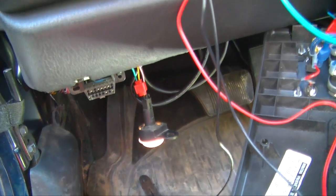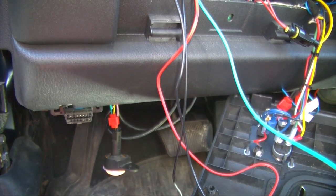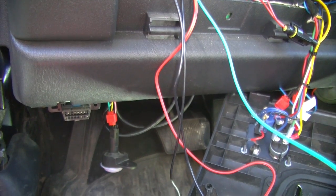For the door trigger, I tied into the yellow wire on the light — when your door is opened it automatically goes negative. The only problem with that is you can't go instant armed, because as soon as you close your door you're gonna have to wait a few seconds for the light to go out. Otherwise you could tie in directly to the door triggers, but you'd need some rectifiers. For an extra three seconds, I don't mind — close her up, wait a few seconds, lock her up while you're walking away.